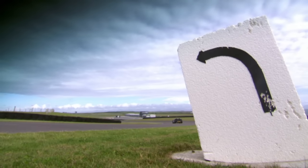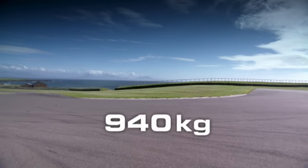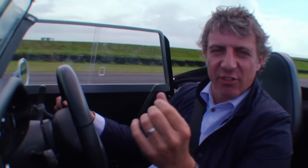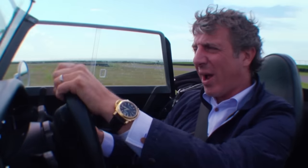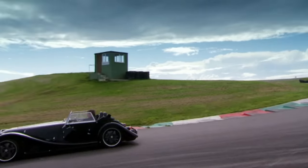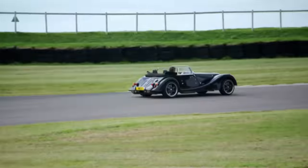But let's take a look at the technology. Thanks to its aluminium chassis, the Plus 8 weighs less than a new Ford Fiesta, which should make it lively to drive. It's very easy to promote it to a bit of oversteer, which might sound like fun, but the problem is the steering — when you then correct it, you lose all feel of what's going on with the car because it weights up too much. It suffers from a phenomenon called catch-up: if you've got a lot of assistance one way and then quickly go back the other way, the power steering system can't keep up.